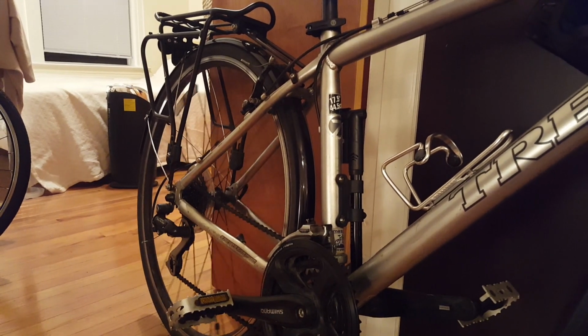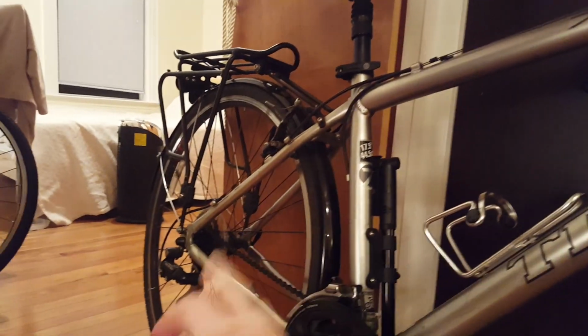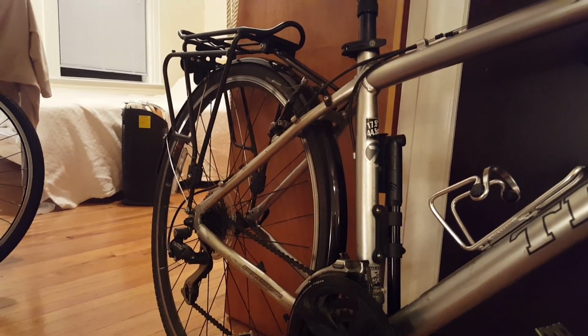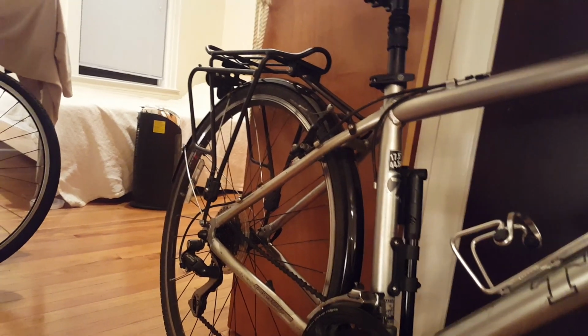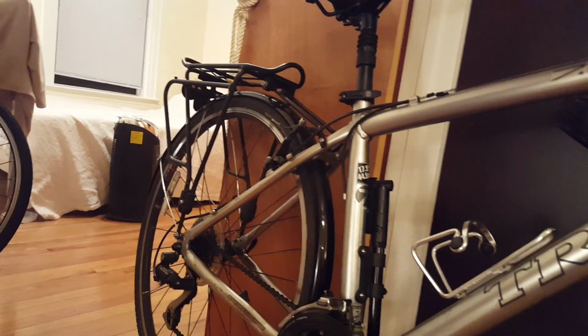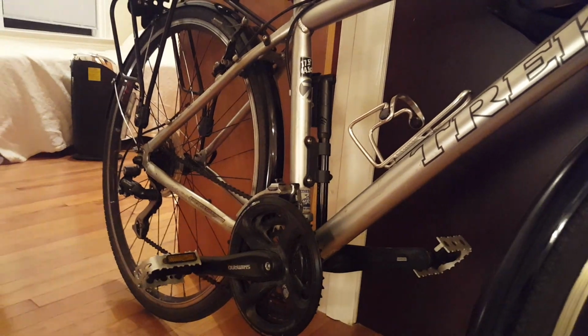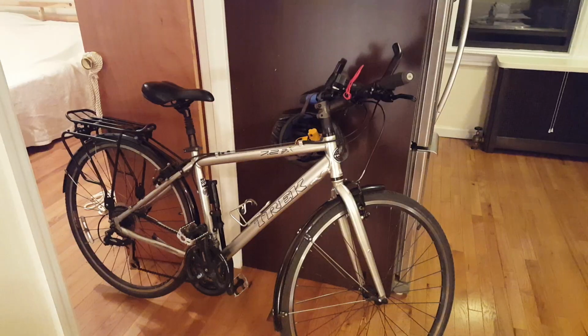My bicycle was skipping gears, which meant that the tension on the cable going from the shifter to the derailleur was wrong and needed to be adjusted. You do that by spinning the pedals and going through all of the different trigger shifter settings and making sure that the chain is going to the appropriate cog at the right time.